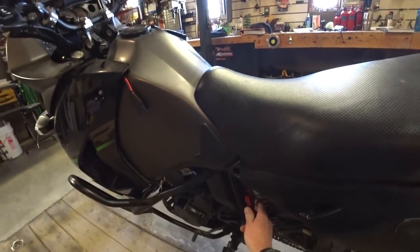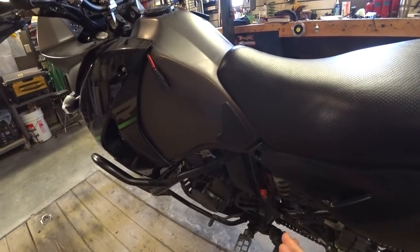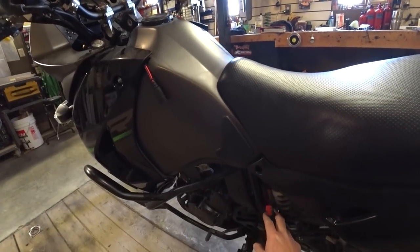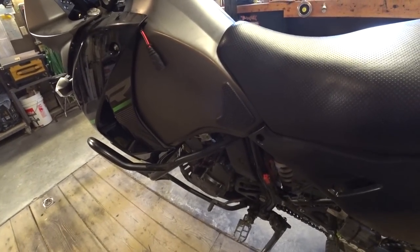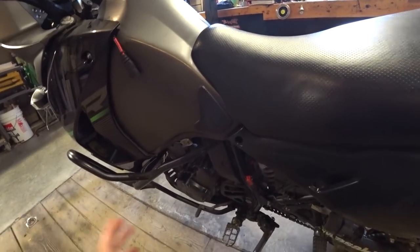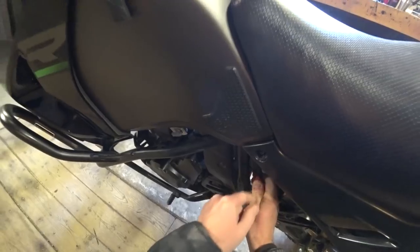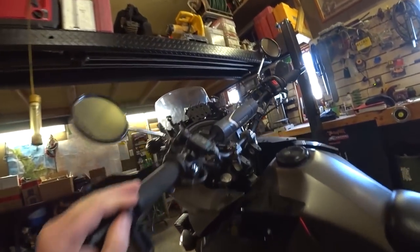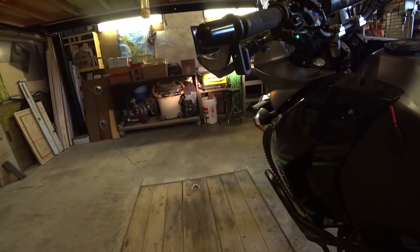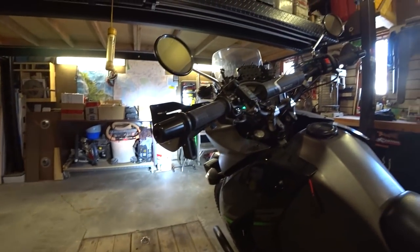The other reason for this disconnect is that if I'm having an electrical problem on the trail, I can unplug this and isolate anything I've ever done to the bike away from the rest of the machine — try to get it running and see if there's a drain from any accessory. It gives me a point to start troubleshooting from. When it gets plugged back in, all my accessories work.